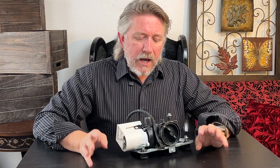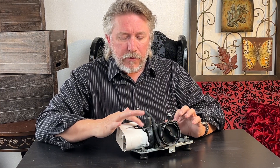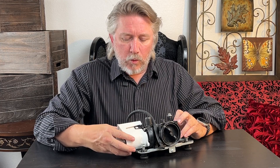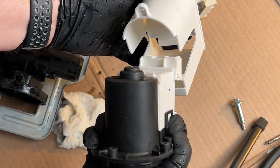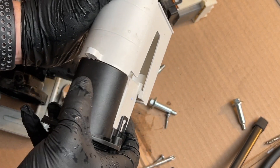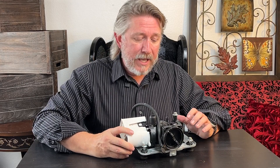I've got this installed. The only thing you need to do is take off the three screws from the housing and the old one comes off, the new one goes on. You will need to swap this white piece from your old pump to your new pump — that doesn't come with the pump, but it's just protection for your electrical connections.